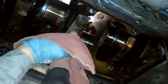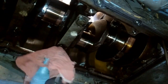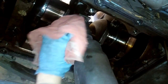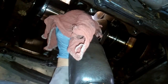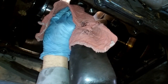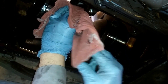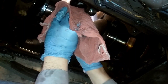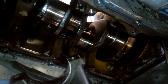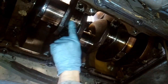These are just main bolts — they are fairly tight. Usually a half-inch impact will remove them. If you've never done this before, the first time you pull this bolt out they stink horribly. Oil gets trapped in those main bearing bolts, it gets super hot, it'll burn, and it's a rotten disgusting smell — anytime you do mains you'll never forget it. So remove both bolts. Do not ever leave that main cap up there without bolts — it's fairly heavy, probably about five pounds, and if that sucker falls out without a bolt it will break your face. Be careful with the bolts too. Now you're looking at your bearing and your bearing journal — this one looks good, no deep gouges or anything in it.